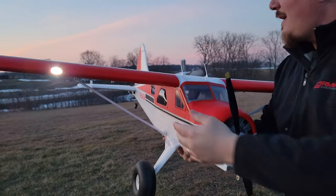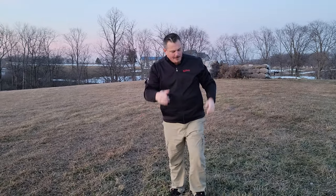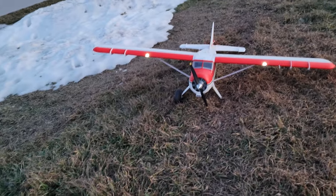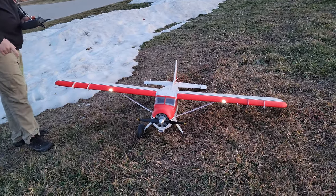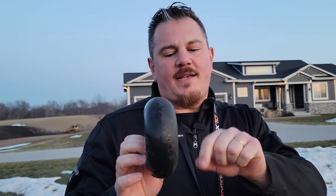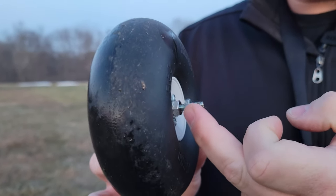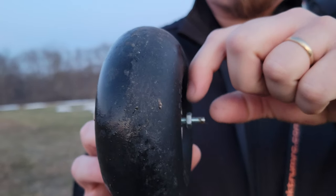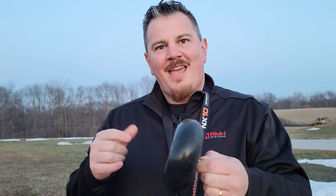Look at the ground clearance on this thing — if I'd gotten really lucky I probably could have put it down on the runway. My remedy: I'm going to find the right size nut. I have a lock nut here, and this would have been the inside jam nut and the outside jam nut. I'm going to put a second jam nut, and I'm probably also going to apply a little Loctite so this thing can spin free all day long and not walk itself off. I prefer a jam nut over a nylock in my personal experience.